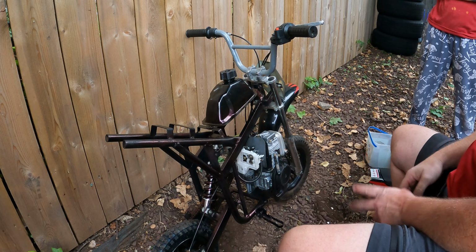See this here? It pushes up on the flap over here to cause a choke. Without this piece of metal I put here, it just moves freely and constantly chokes out. Now this thing is not running without choke. So maybe that's why it's like that, because they didn't know how to get it to run properly. I need to make a new one of these, and it should run without the choke. I gotta make a new spring so this will work but not flap. Basically, I'm just making a pressure point for it.